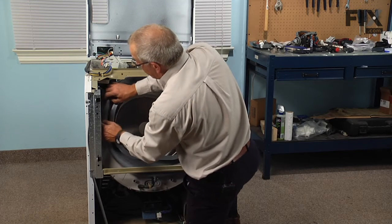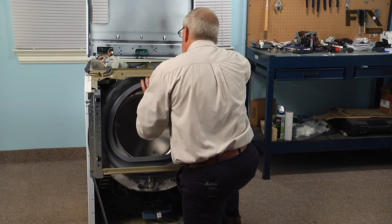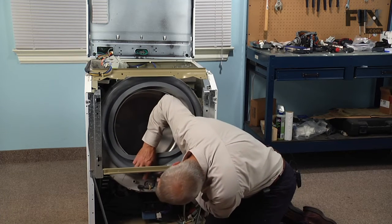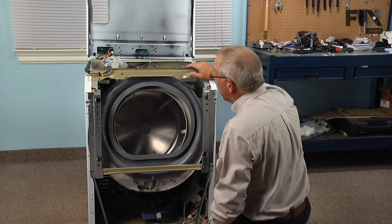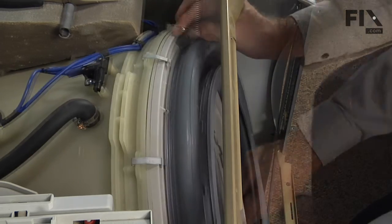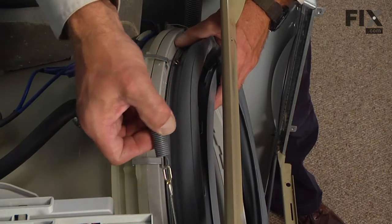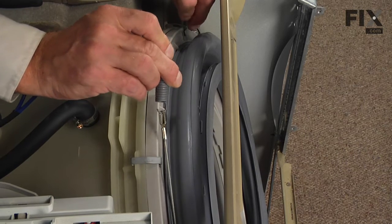It is a silicone type of rubber so it's quite sticky and doesn't slide well, so just work a little bit on either side. Once you have it pulled all the way around the circumference of that lip on the tub cover, check those location marks to make sure you have it centered properly. Once we have that in place, we can wrap the wire band around it and reconnect the spring. Hook that spring up under that portion of it, and carefully try to slide that wire enough that the spring will be just past the twelve o'clock position.